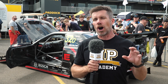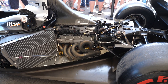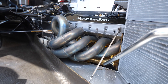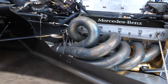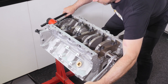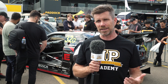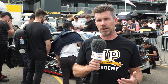Now there is an old wives' tale that the likes of Formula One engines, where we see this operation being undertaken, is because the tolerances or clearances inside the engine are so tight that if this wasn't done the engine wouldn't turn over. Now that's just not the truth — clearly we're going to need to be able to turn the engine over when it is at room temperature. However, the clearances inside the engine will change dramatically from ambient temperature through to running temperature, so preheating everything just gets all of those clearances where they need to be, helping to eliminate wear.